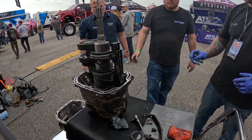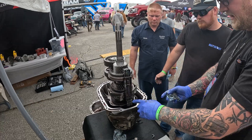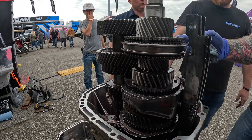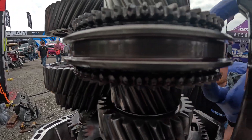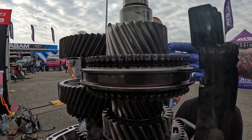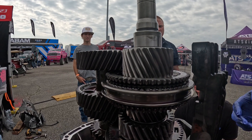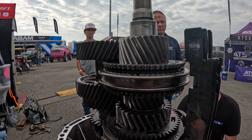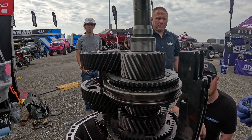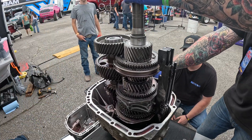This is the completed gear train setup for a G56. Right now we're in neutral because all the gates are there — neutral means that all these sliders are in the middle. There's a hub inside and on each side you see it like a sprocket almost. These sprockets are actually what drives the gear. A lot of people think that when you select a gear you're connecting one gear to another, but these are always in constant mesh and always spinning whenever your foot is off the clutch. Whenever your foot is off the clutch, this is being driven by the crank — your input. Whenever your input is spinning, your front counter shaft gear is spinning, which means the whole shaft is spinning because there's nothing selectable on it.